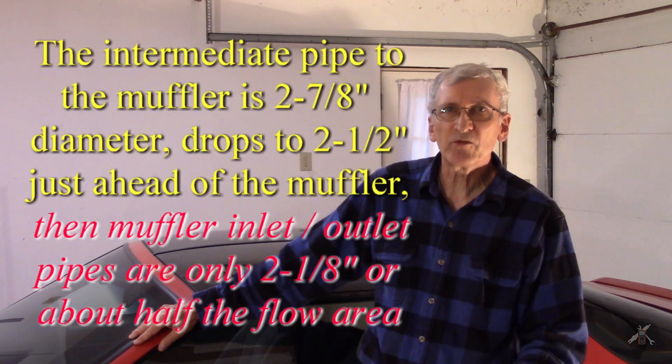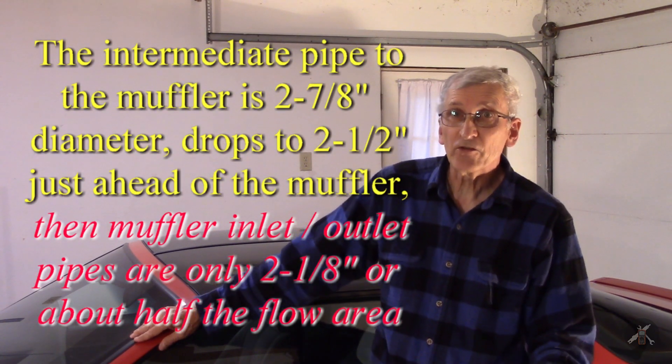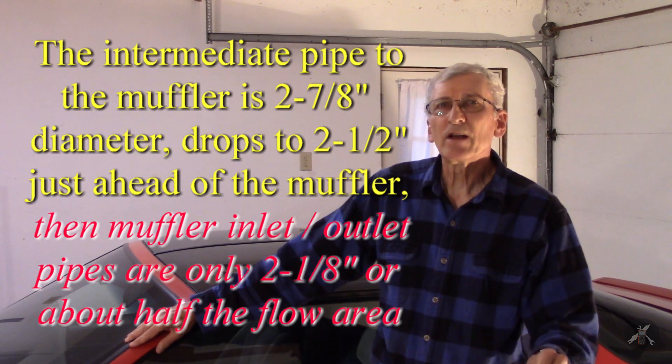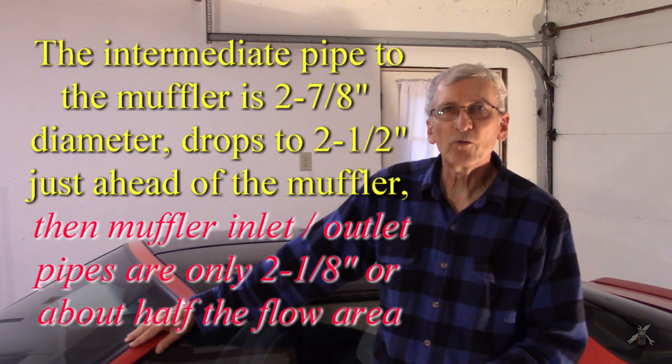And frankly, it's pretty satisfying. It really boils the tires when you romp on it from a stop, and it accelerates very well. I think the power is down a little bit at the top end, but I think that's a function of my exhaust system still being restrictive — it's still a stockish type muffler, actually more restrictive than stock looking at the pipe sizes going in. It sounds nice though. I've got plans to go through the exhaust system and try to free it up a little bit.